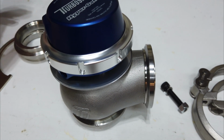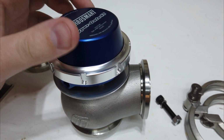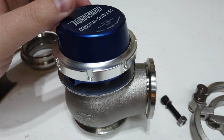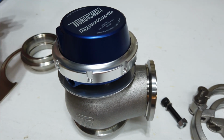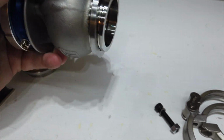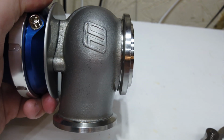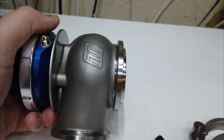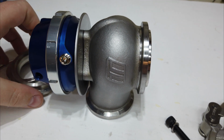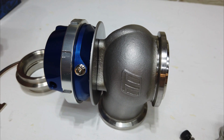I've also had a quick think about where I'm going to fit it, and after seeking some advice online, they're saying about fitting it after the factory resonator, which is what I will be doing in the next video. I'll probably just be getting the car jacked up and the exhaust off, and then showing the process of cutting the pipe work and then welding in this. The plan for me is to weld this in like that on the side of the exhaust pipe, so that the wastegate or bypass valve blows down onto the floor. So it'll give me a bit more noise, but because it's after the resonator, it won't have that horrible cheap, bean can exhaust type sound.